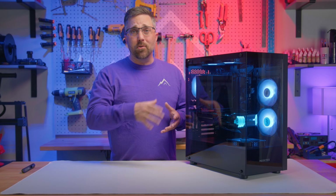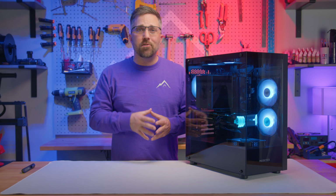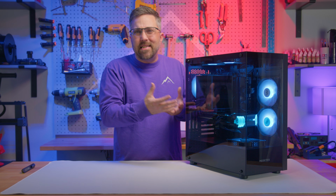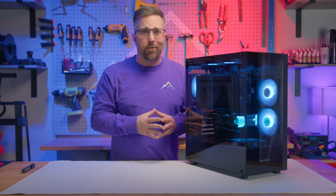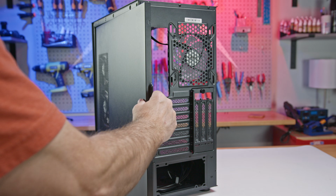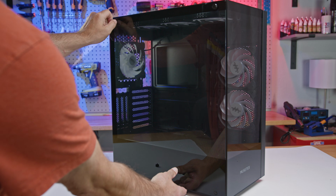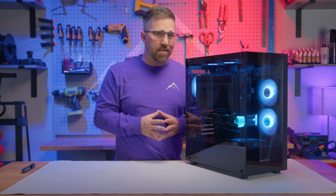When examining the build quality and materials of the Musetex K2, it's clear that Musetex aimed to balance quality with affordability. The case is primarily made from about 22 gauge steel, standard for sub $100 PC cases, and this is a sub $100 case with about $20 worth of fans in it. The structure is robust, the panels align well without any noticeable gaps or odd angles. I didn't experience any issues with the thumb screws or standoffs stripping out during multiple assembly and disassembly cycles.